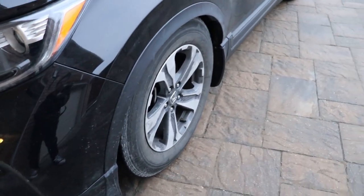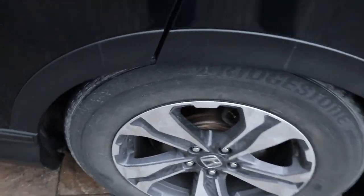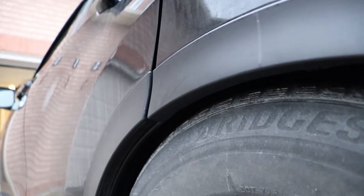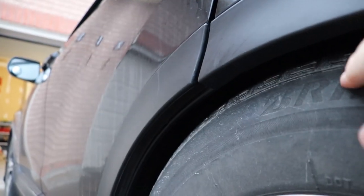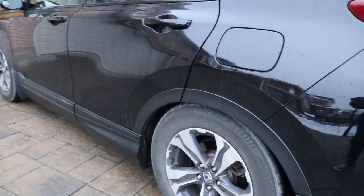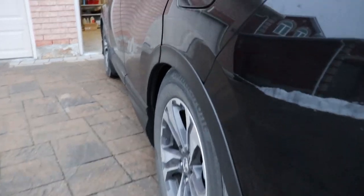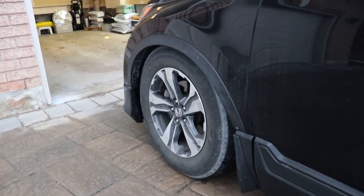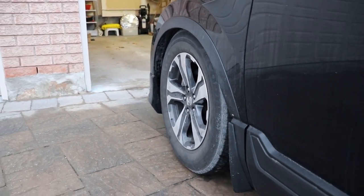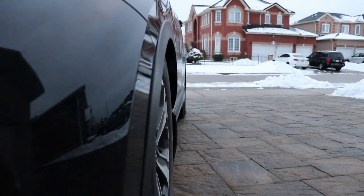The current fitment on the CR-V lowered stock — the rear has a camber arm. With the 20 millimeter spacer, I don't really know how to roll this type of fender, and the plastic will make contact with the tire if it didn't pull all the way in. So for now the camber is pretty much maxed out, and I do have to adjust it a bit later. From the side you can really tell it's super tucked in and there's just a huge gap. Same thing for the fronts — you can tell it's not even close to being flush after lowering it.